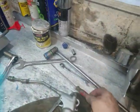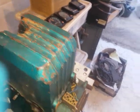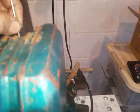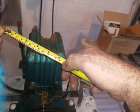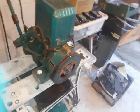One thing to check first: use a screwdriver through the spark plug hole to feel how high the piston is. Because I could move it a certain amount, I knew it wasn't at the top. If you don't want to take the exhaust off, here's a useful measurement: push the screwdriver down vertically until it touches the piston — in this seized position that measured 90 millimetres from the top of the spark plug hole.